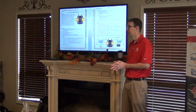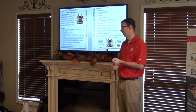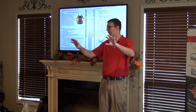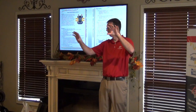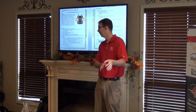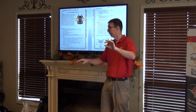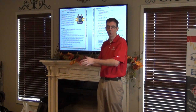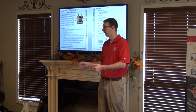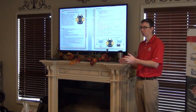One inverter panel says full charge most of the time — you have a 2,800 watt and a 2,000 watt. One of them becomes the master and one becomes a slave. The master sits back and lets the slave keep going — if needed it'll come on. One charger can charge all eight batteries and keep up; the other one is there for the inverting side. It's normal to see one on full charge and the other on absorb or float.